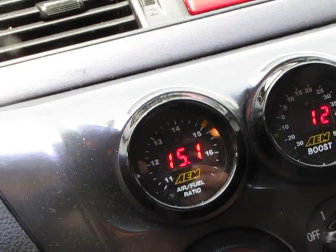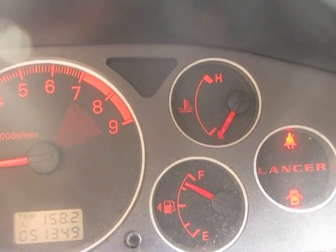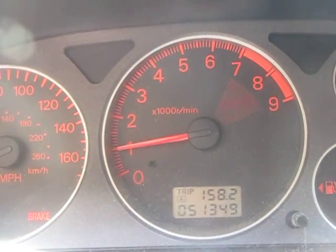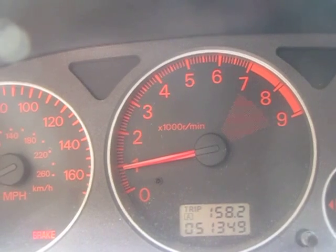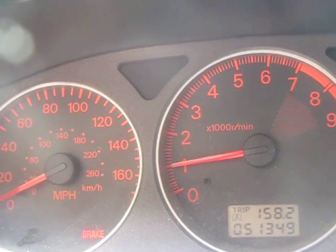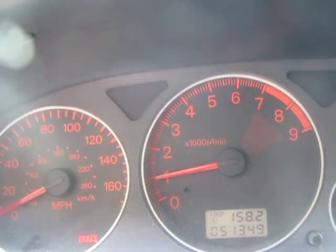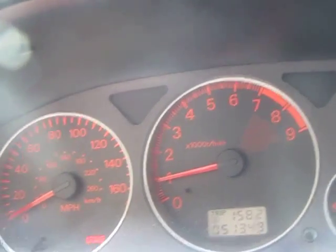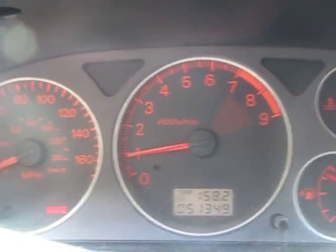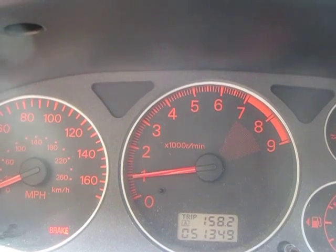The car is completely cold — here's proof. Coolant is completely cold. The car does not have a high rev idle when it's cold; it's programmed in the idle air controller stepping motor system to maintain a thousand RPM idle at all times. You can see it's a very calm idle — it's not hunting or anything, it's very solid.